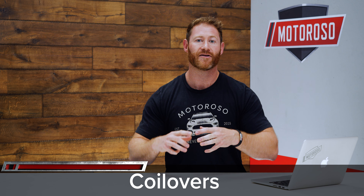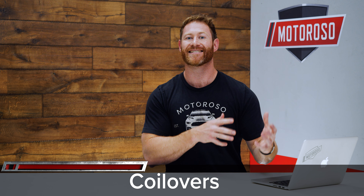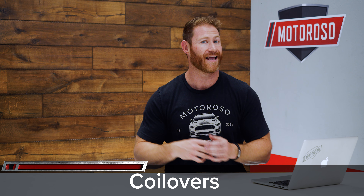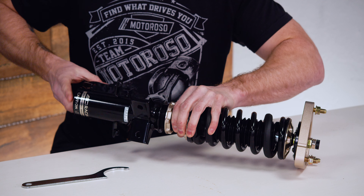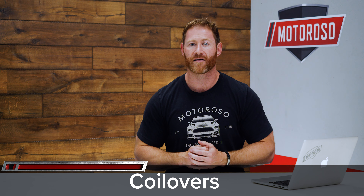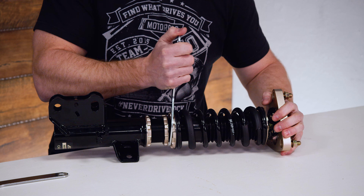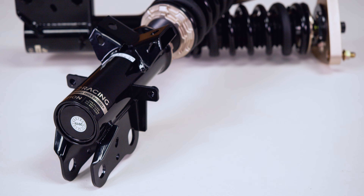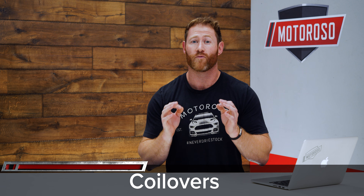One of the main differences between the WRX and the WRX STI is the claimed better suspension on the STI, but all that really means is better valving, a lower ride height, and stiffer spring rates. Even STI owners will be looking for improved suspension via coilovers. Coilovers allow you to adjust ride height, spring rate, and damping, giving you much more control over suspension performance as well as the styling that comes with being able to lower the vehicle.